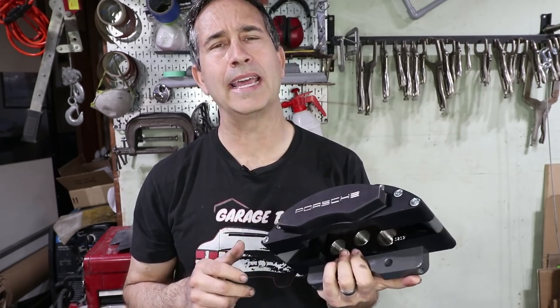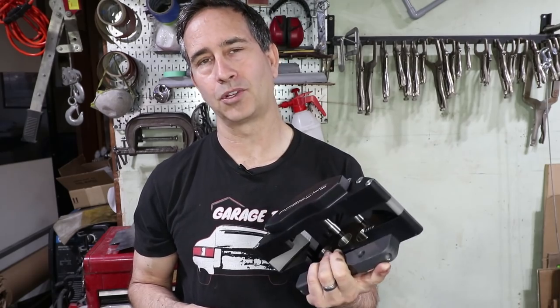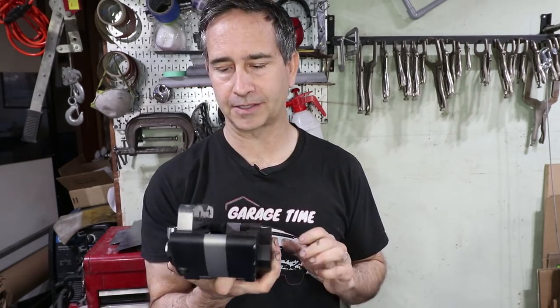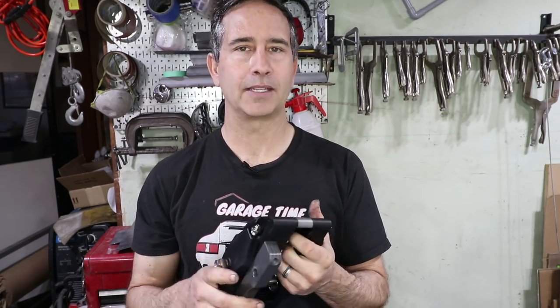They will fit within the 15-inch Fuch wheel envelope, so I intend to run sort of those period look wheels, and these brakes are obviously super important and key to be able to run a 15-inch wheel. So with the Boxster brakes, that may not have been possible. I'm really happy with these. Thanks again, Chris. Really excited to use these. So I just wanted to show you the calipers. I'm not going to be mounting these today, but this obviously goes along with how I designed the brake system